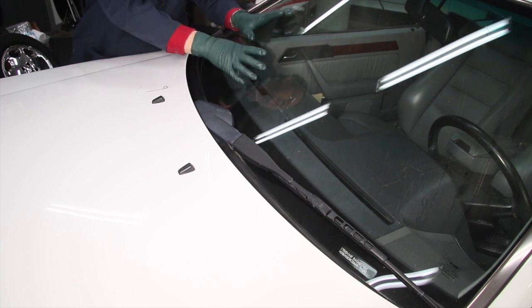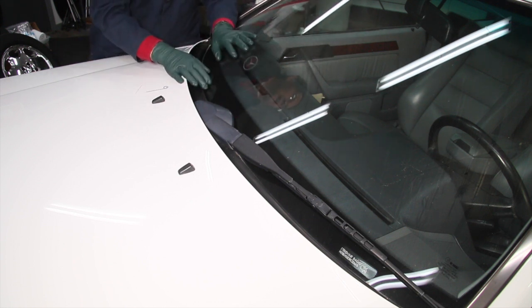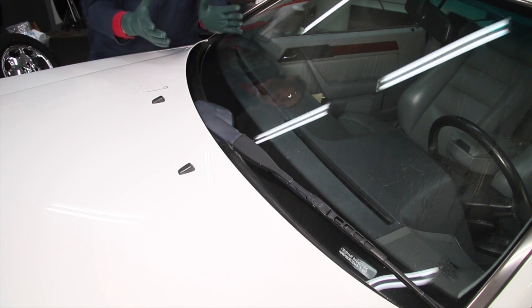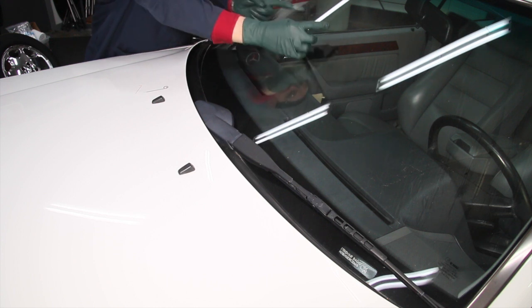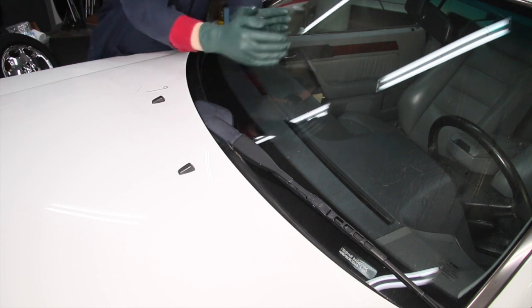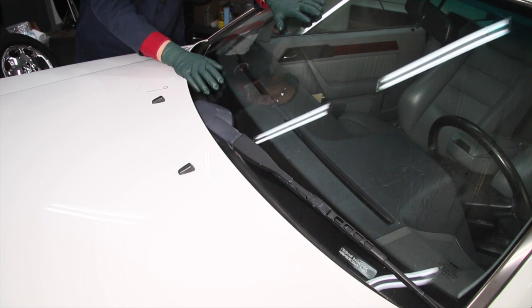What you'll do is get in and use your windshield wiper and squirters to test. It may squirt low, and you'll have to adjust it, and adjust it again and try again. So there's a little bit of trial and error, and there's no precise area where these need to hit the windshield. You'll be able to tell after driving the car. You generally want to have it come up and hit right about in the center of the windshield, maybe a little above center, and you want them spread out 6 to 8 inches, so you've got good coverage this way, and the same on the other side. So don't be afraid to experiment a little bit. Like I say, it may take 3 or 4 times testing your wipers with the squirters to get them just where you want them.